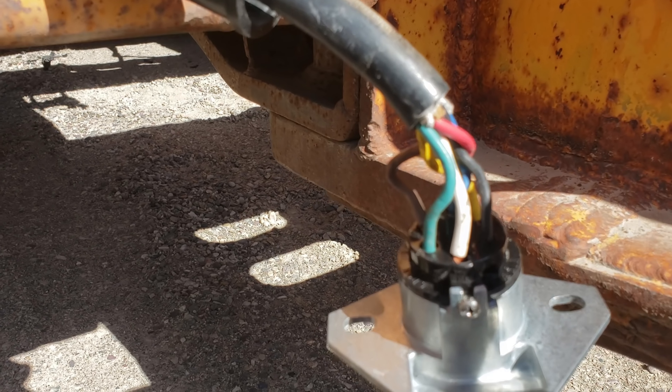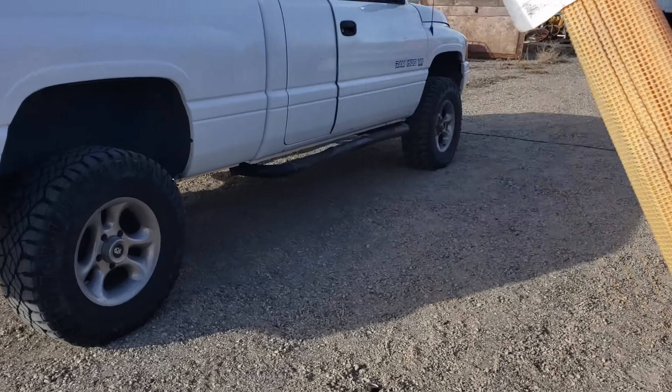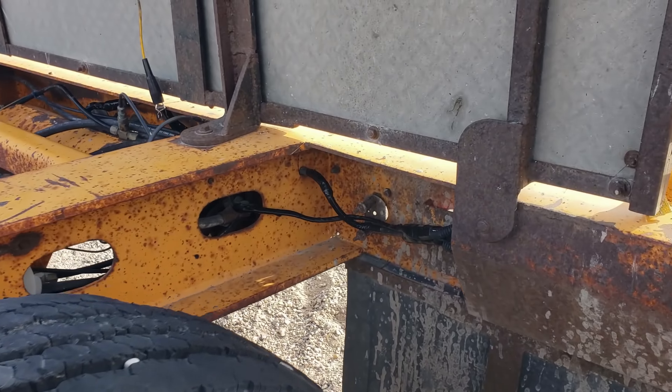After working on it all day and running a separate ground for these outside markers and the inside ones, I finally got them going and got tail lights all the way around. Time to clean up the tools and call it a day. All day Sunday out here working on this — got four or five plug-in connections on this trailer and probably that many rubber connectors where the harness hooks together. I hate this wiring system on a big long trailer, but it's working now.